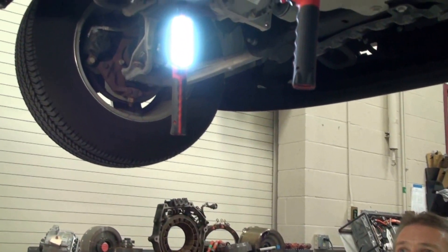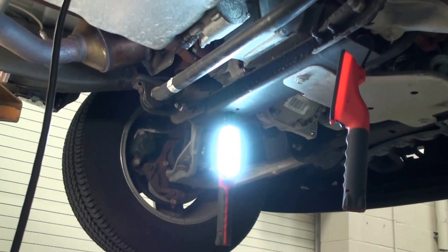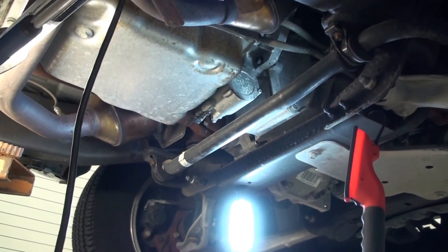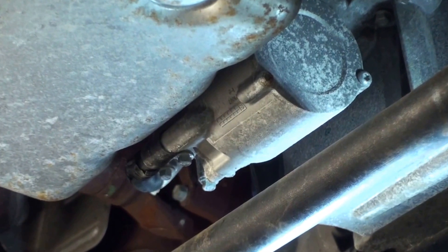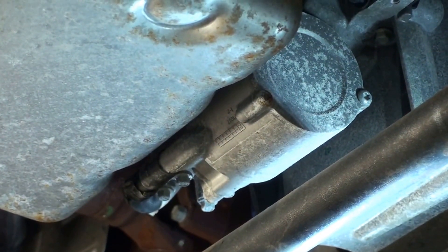As you may be aware, some of these hybrid vehicles have hydraulic clutches inside of that transmission, and if they do have hydraulic clutches inside of the transmission, they have to have a way to maintain pressure during idle stop, otherwise all of the clutches would disengage and we'd have a delay before we were able to take off again.